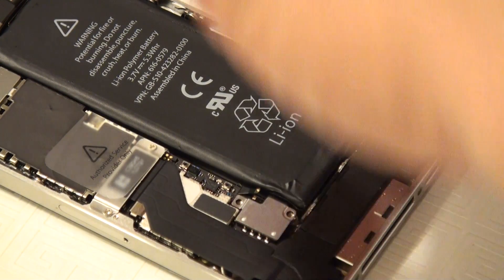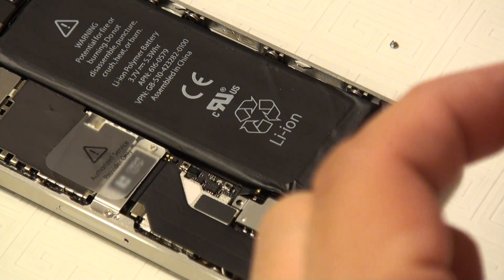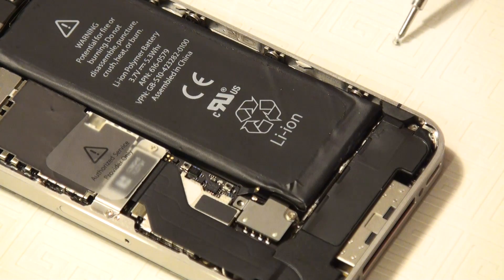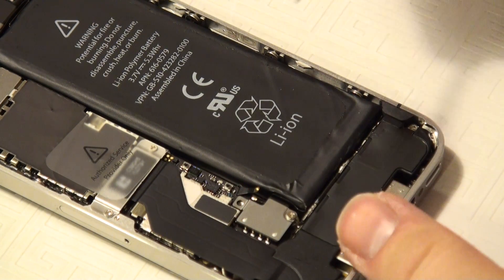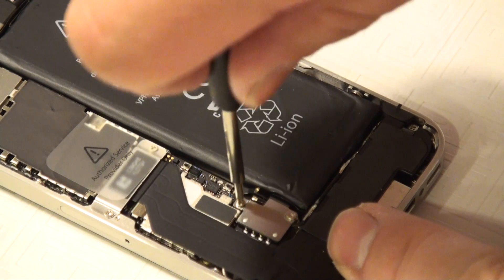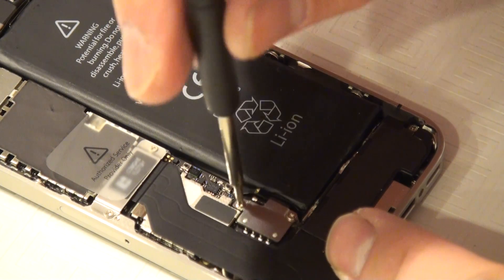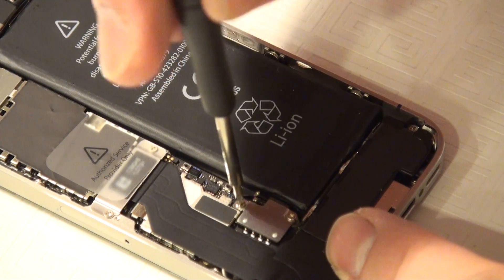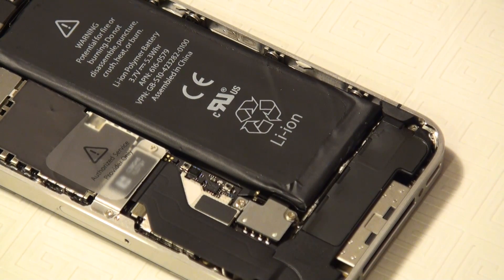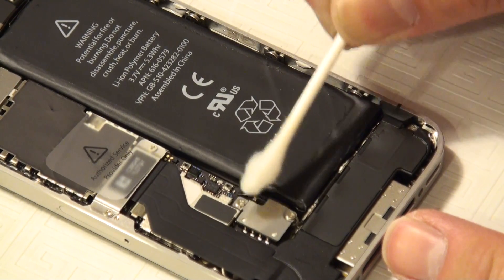As mentioned earlier, we have two microscopic screws: the 1.7mm longer one goes on the lower position, and the short upper screw passes through the battery connector cover and then through the little grounding spring. Just use your screwdriver to line it up as it was when we removed it, then finger-tighten the screws — they don't need to be torqued down hard, remember these are tiny screws. Then take your alcohol-covered Q-tip and clean the top of the grounding spring area.